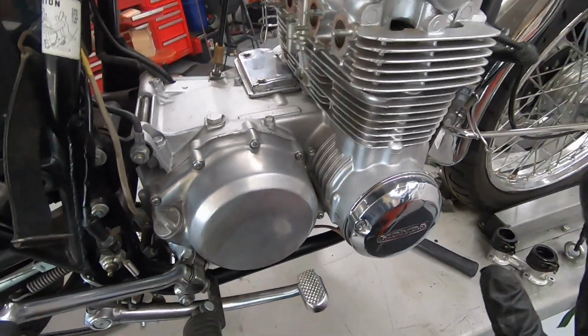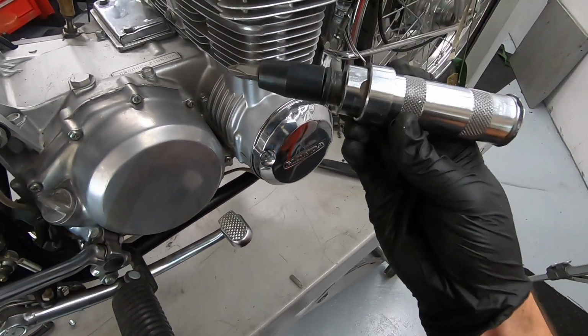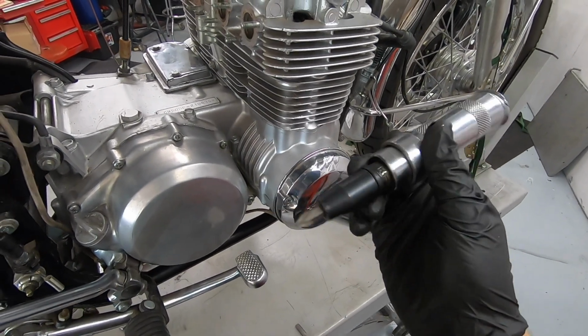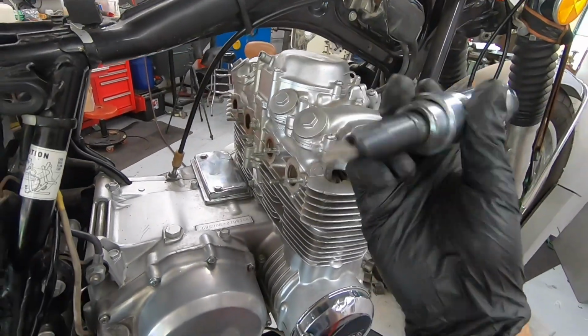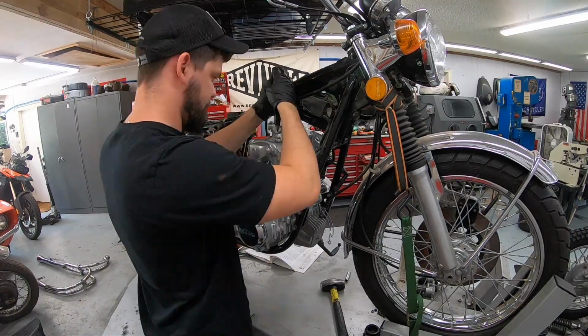I've mentioned this a million times, but it's worth mentioning again. If you guys do not have an impact driver, get one. They are worth their weight in gold on these old Japanese bikes. These little JIS screws are very easy to strip without the proper tool. I'll throw a link to this one in the description below, but they're pretty universal and they're not crazy expensive.